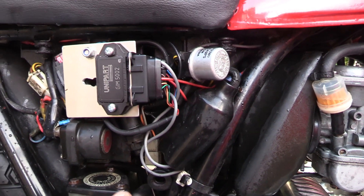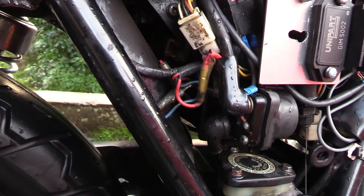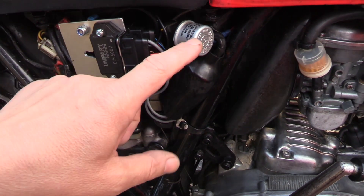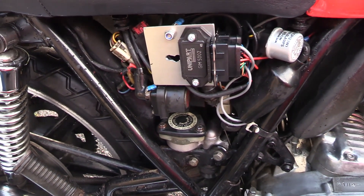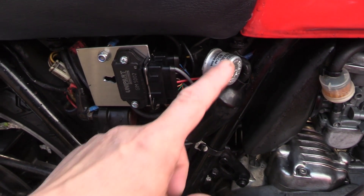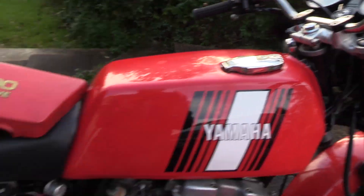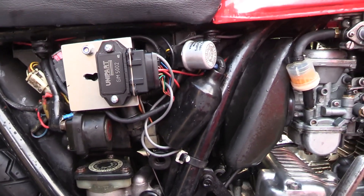Coming back to other things on these motorbikes — the original bikes had self-cancelling indicators. The self-cancelling indicator module is crammed behind all the wiring. If your self-cancelling indicators aren't working, make sure you've got a three-connection terminal on the flasher unit — this one hasn't, so my flashers don't self-cancel. If that's correct but it still doesn't work, either the module has packed up, or there's a reed switch inside the speedometer — if that's fractured or broken, it won't self-cancel, as the system relies on time and distance measured by the speedometer.